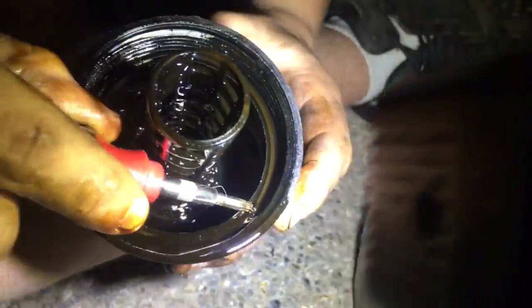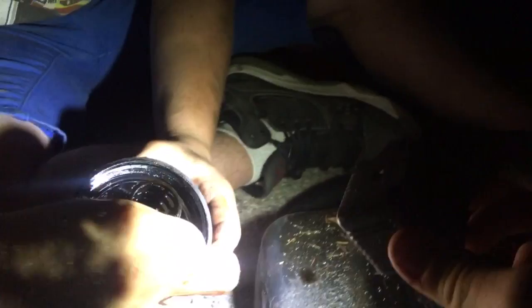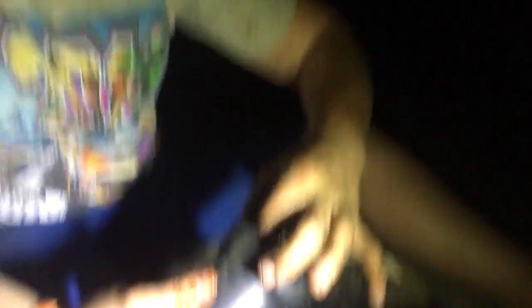Don't forget about this little gasket on the inside of your filter housing. If you forget about that, your engine could basically explode. So remember that — one, maybe two things: you need to fill it with oil again. There it is, that's a big one.